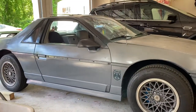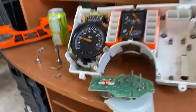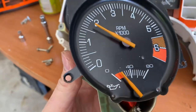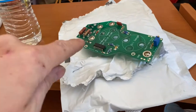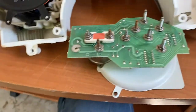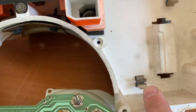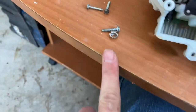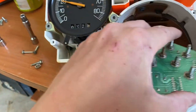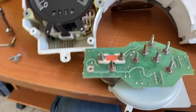We're tackling Fiero issues. Right now we're getting a tach gauge that is hunting around everywhere. Our plan is we ordered a new circuit board online, so this is going to take the place of this. We also had a little ground or supply down here that wasn't functioning properly — it wasn't bolted on all the way. That might have been part of the issue with this reading so high. So we're going to take this apart, put it back together, and hope that fixes the issue.